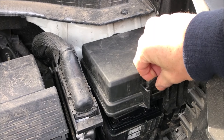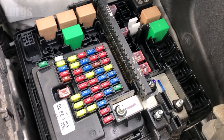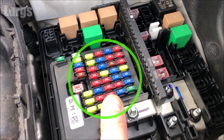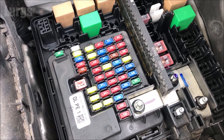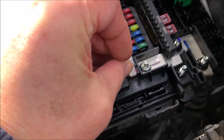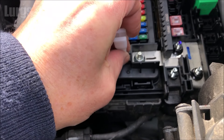That is where your fuses are. These are horrible mini micro fuses — if you've got sausage fingers and thumbs like me, they're really difficult to get out and test. I don't know why they didn't just use standard size fuses. In this fuse box you've got these fuses, some relays, and some bigger heavy-duty fuses. Up here in the right-hand corner is your fuse removal tool — squeeze it, place it over the fuse you want to remove, and it clips into place.